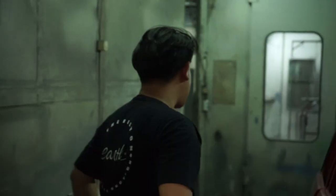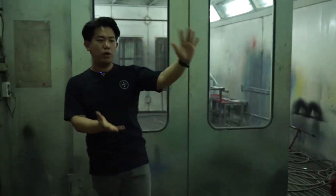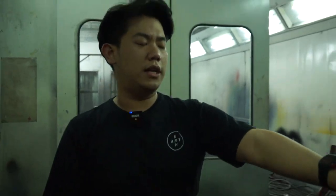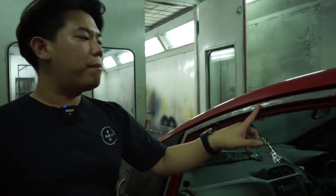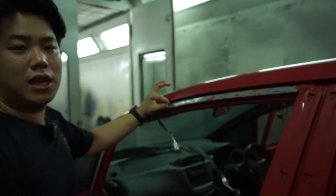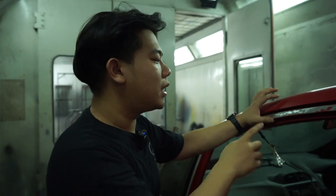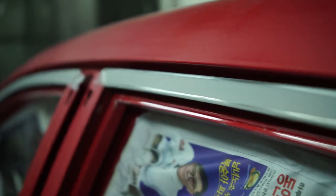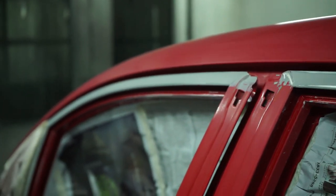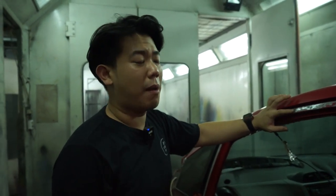The car already looks like this but we're not painting yet, because there are still many finishing steps remaining. For instance, the factory window trim on every Honda Jazz comes with a sticker coating, and since it's a factory sticker, we just scrape it off. We don't want our new magic paint to peel because the base wasn't properly cleaned.